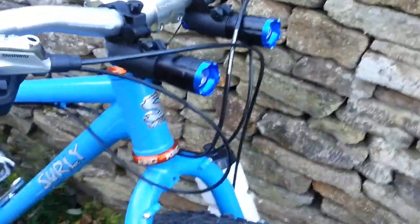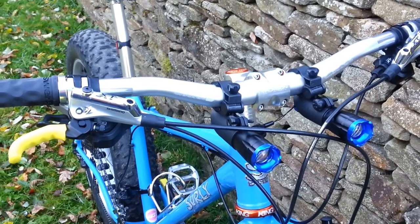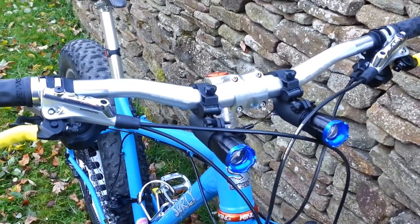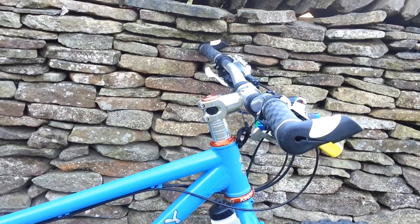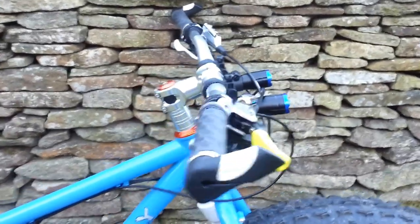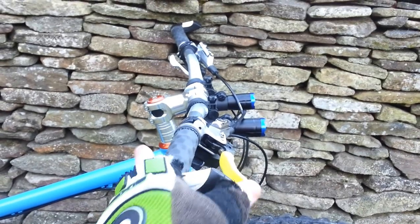Oh I'm freezing! My bars just turned up. The best bars I've got are off my brother Mick from Oz, but they sort of go on the bike, come off the bike — to me they're like a collector's piece, off a good friend, and I don't really want to run them. So I chucked these triple butted fat boys on — 785mm wide, 30mm high. Double lights on the front, because I think I'm getting old and I'm going legal, so I chucked some lights on her. So that's the front end: Thompson zero stack, 35mm, zero degree on a 70mm stem, 785mm wide bar, 30mm high. BBE bar ends on the end — quite rubbery, they're nice but a bit too short. I think I'll get them in a 45 with a 65 or an 85. If you've got bigger hands go for 85s, because there's just not enough length to get your hands on.